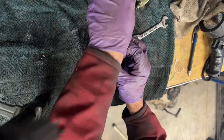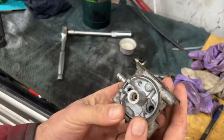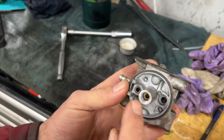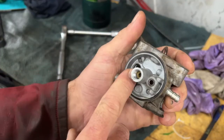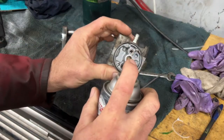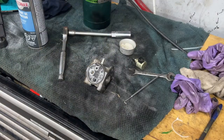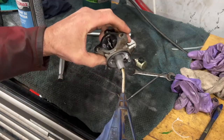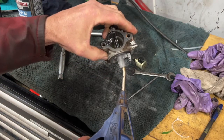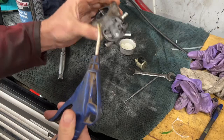Check this pin out. Check out the float there. So this carburetor looks really good — that's not plugged. This side jet here is not plugged. I'm going to put a little carburetor cleaner in here, try a little compressed air here. Looks good, it's coming out of here.